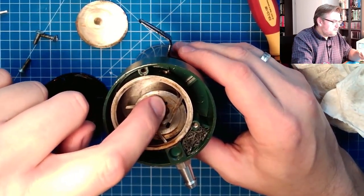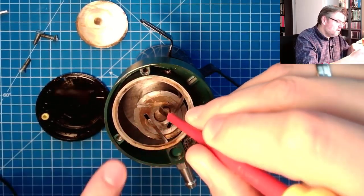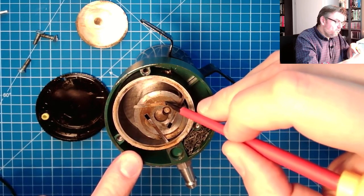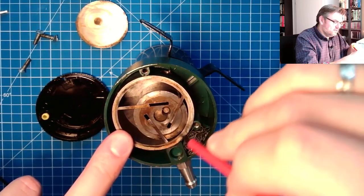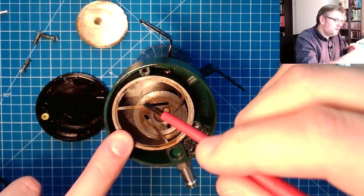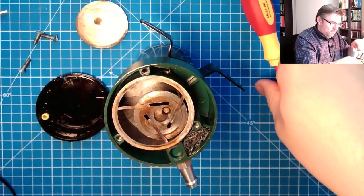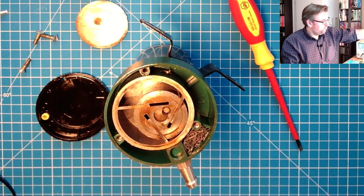And why is it sliding out? Look at the construction. Here, there is more. Here is less. So the centrifugal forces will move it in that direction. The centrifugal forces will simply hold this, because this is rotating quite fast then. The centrifugal forces will hold this to the outside. And so it is sealing here. I guess it's not sealing very well, but well enough. At least 40-50 years ago to blow the horns.